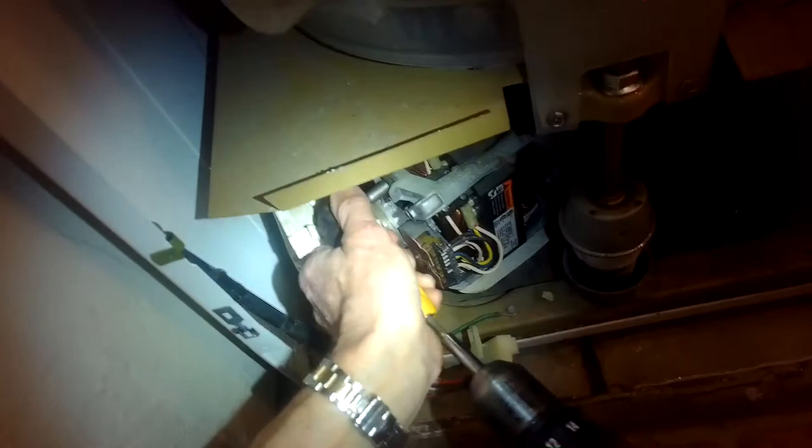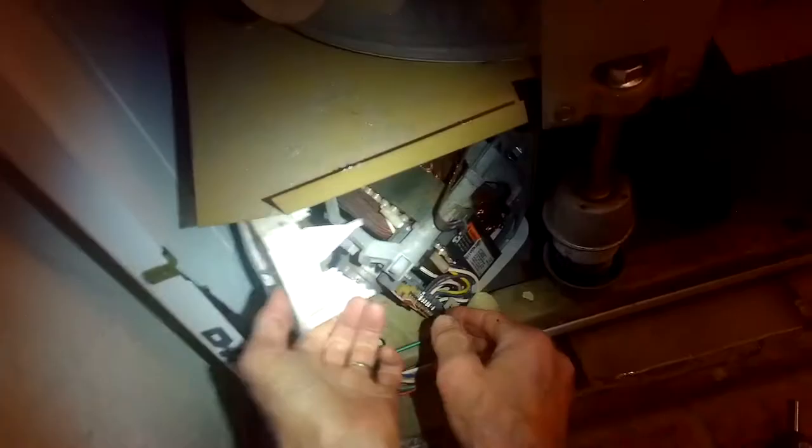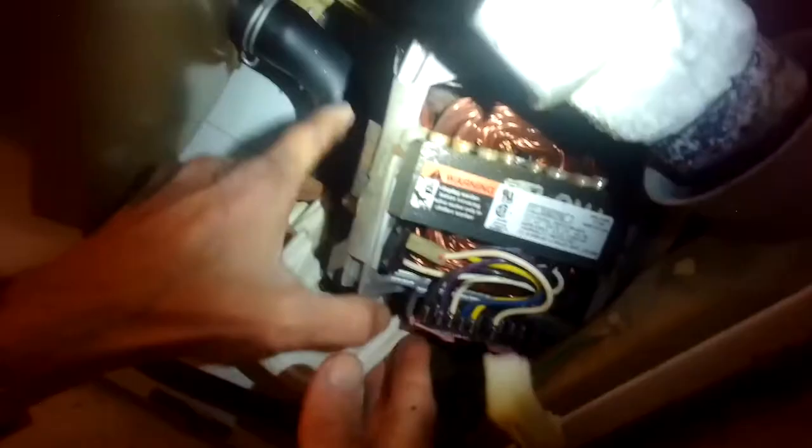There are just two screws — one at the top and one at the bottom. I'll zip out the screw at the top and then at the bottom, then release the two spring clips that are holding on the motor. They're connected between the motor bracket and the motor itself. I'll take a standard-head screwdriver and pry the spring clip off the top — that releases the top one and the bottom one comes off too. I'll get the spring clip out of the way, twist and pull it out of the motor mount in the back. Now I can lift up. These are kind of heavy — maybe 10 to 15 pounds. I'm going to wiggle it out of its tight space. That's the motor, and it does smell burnt.